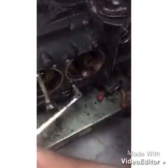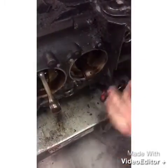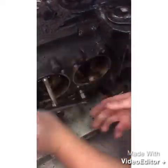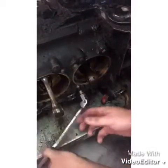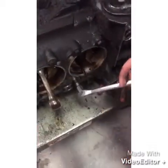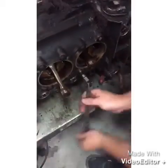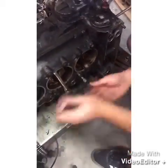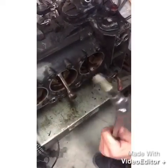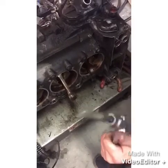I've actually used these tools on all of them, even the unbroken ones, because I was not saving any of the studs. You can just hammer it straight onto the threads — use the one size up on the non-broken studs and it works fine. Since I'm not reusing the studs, I'm going to ARP studs, and it's much easier than a pipe wrench.